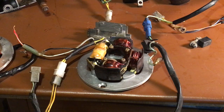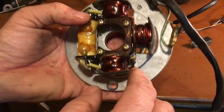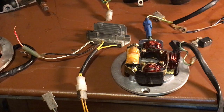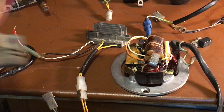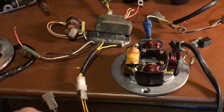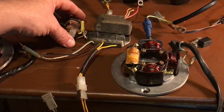Now we're going to take this one step further. Everything I showed in my last video on converting to a 12-volt system — you center punch the two marks, tap them, grind out some of the aluminum, and you can put this coil from a Yamaha Moto 4 in place with its matching voltage regulator. You've just taken your 1970s G390 or Trail Boss 100 and converted it to CDI with a 12-volt ignition.